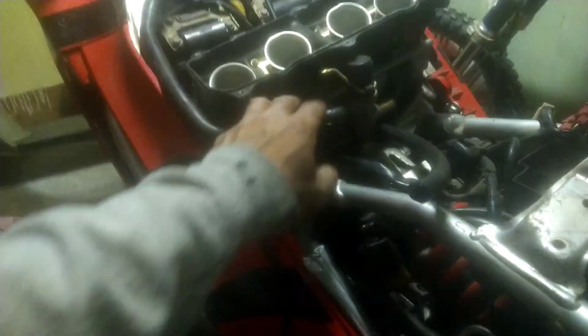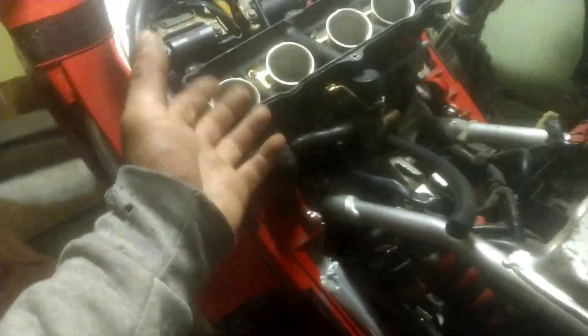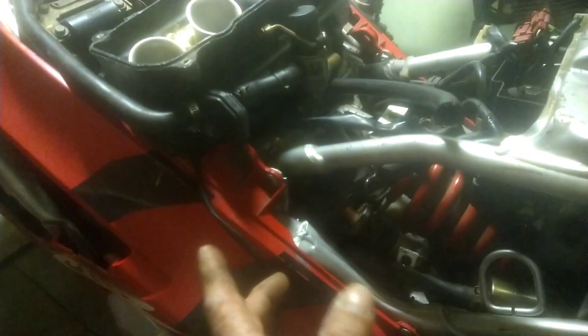I'm trying to check my diaphragm parts. Once I figure this out, I'll pull out the carb. There are four lines in the carbs that I've got to put in — I'm trying to figure out the placement on those lines. What I gotta do is store the carb back. Hopefully everything important is installed, like this fuel line that I have to connect here for the fuel filter, then at some point connect the gas tank back. Throw some gas, get a battery, hopefully no leaks, and get it to turn on.